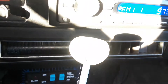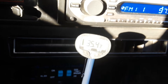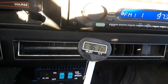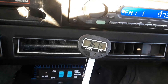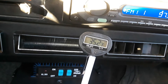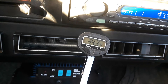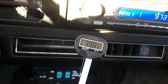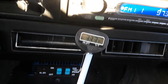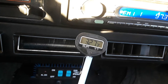Alright folks, so I'm back in the 89 Jeep Wrangler YJ. Let me put my hand in the right position to cover this. You can see that AC is blowing out about 36. If I turn it all the way down, it'll literally get down to like 18. I've got the switch that makes it cycle about halfway, and I'm at an idle. You can see it's going to pull down now. Put some compressors on. Now that's some ice cold AC right there.